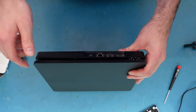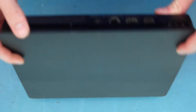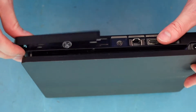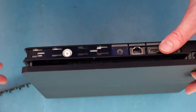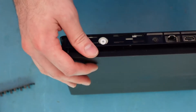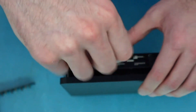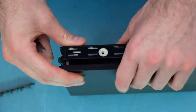Alright, so this is fairly straightforward — they make it very easy for everyone. What you want to do is flip it up like this, which exposes the little side here. And this panel slides off that easy — it looks like it's clipped but it's really simple and straightforward. Now you can see there's actually a screw here, and this screw is really the only thing holding in the hard drive. So we're going to go ahead and remove that — just one screw.